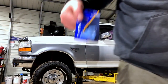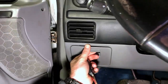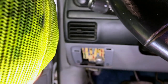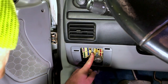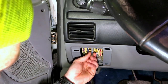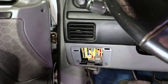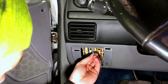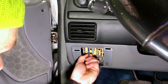The fuel selector valve calls for a 15-amp fuse. Number six is this one right here, and I believe I replaced it with number 11, the radio fuse, because I didn't know why the fuse was blowing — so when I first tried it I pulled the radio fuse since it was the same amperage and put that one in there. I'll replace the radio fuse now. If this fuse blows just from switching that, I've got bigger problems.